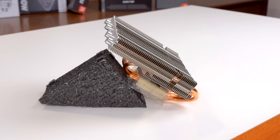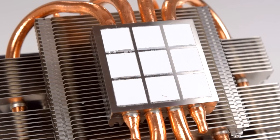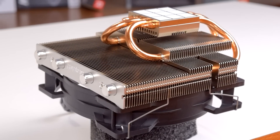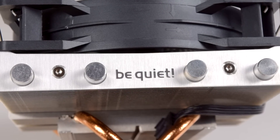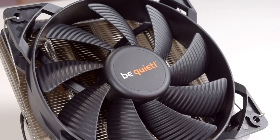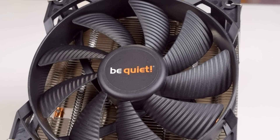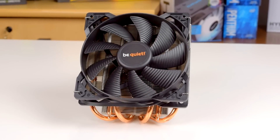The heat sink is fundamentally similar to a tower cooler but folded over — an array of aluminum fins supported by copper heat pipes. The base is a near mirror finish and comes with thermal paste pre-applied. The 4 heat pipes are 6mm in diameter, and two of them wrap around to support a second, smaller set of fins below the main array. The top of the cooler has a brushed aluminum top plate with caps over the 4 heat pipes, a simple but nice touch. The 120mm Purewings 2 fan runs between 300 and 1500 RPM, utilizes a rifle bearing, and does not include any LEDs — just BeQuiet's usual all black design. Overall the Shadowrock LP is 134mm wide, 122mm long, and only 75.4mm tall.